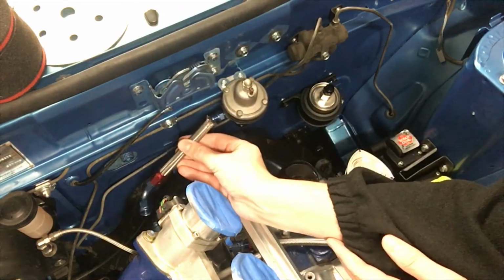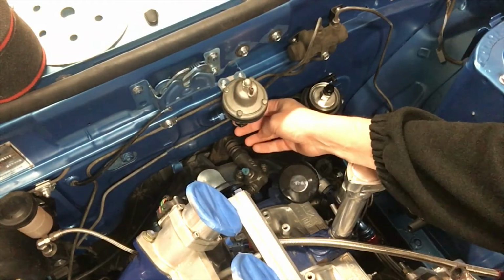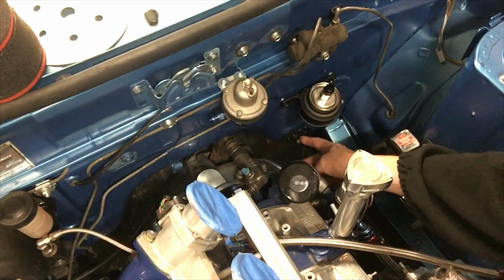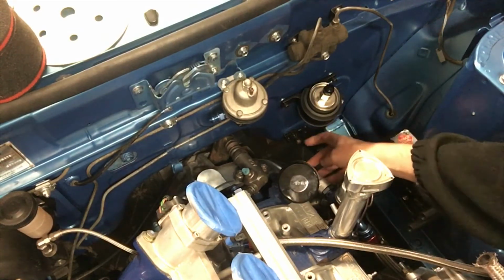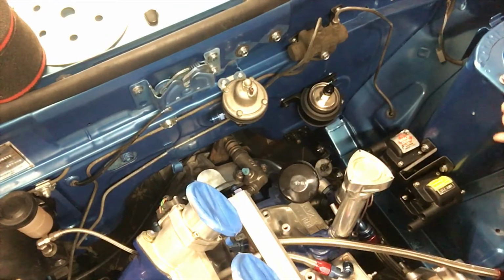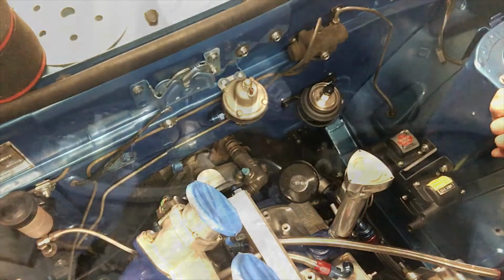So that'll roll up into that, and then it runs the bleed back out of the regulator, which is now mounted up to here, down here, back down to my plastic clips. I'll click in there and run back down to the fuel tank. And then it'll be the fuel system all done once I've made up those aluminium lines. So that's the next job now.